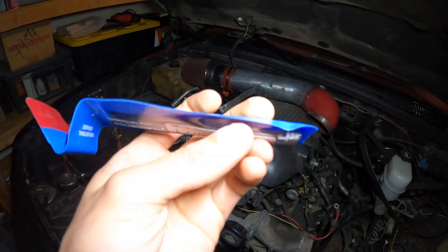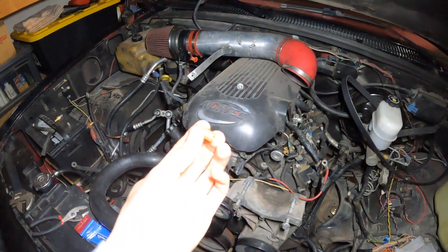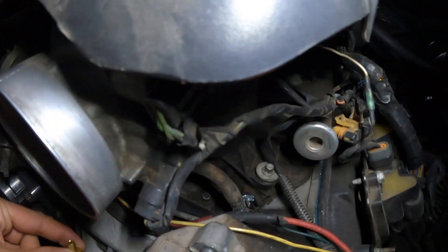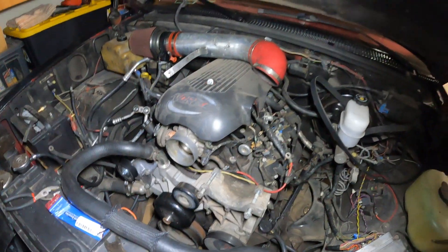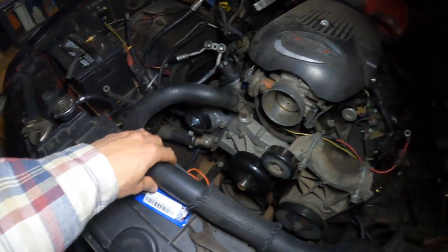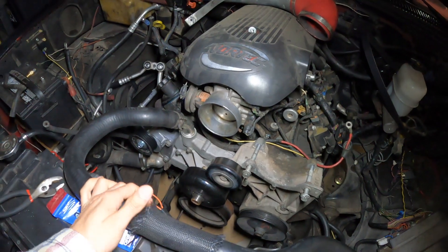So we're gonna go ahead and take off this water pump, drill and tap it 1/8 NPT threads. From there we're actually gonna put it in this little fitting so it'll go right here, and then I'll run that hose from the steam vent over and connect it. It's just a cleaner look, cleaner way to do it. I was leaning towards just getting a little piece that goes up here but everybody says to do it this way, so that's what we're gonna do.